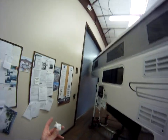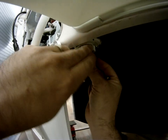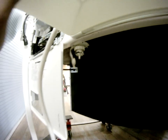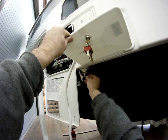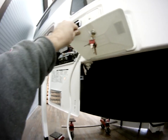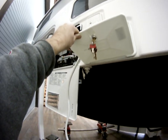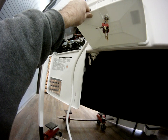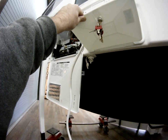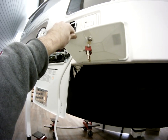You'll need your air source and your blowout plug. Connect to the city water connection right here and install your blowout plug. Then take your air source and blow it out through the blowout plug — no more than 80 PSI; 30 PSI is ideal. A bike pump will do. You can go to the gas station to use their air, or get a portable 12-volt air compressor at Harbor Freight for around $36. Make sure you blow it out and that everything is open — that's going to blow air through the lines and get everything cleaned out.